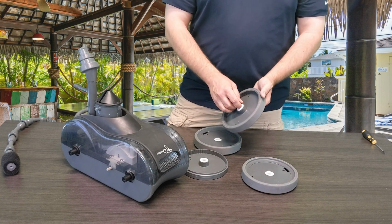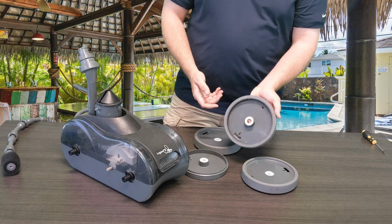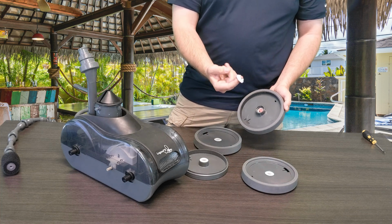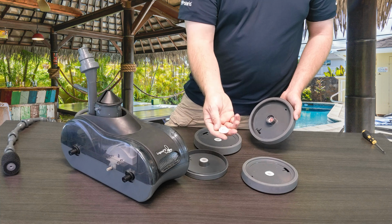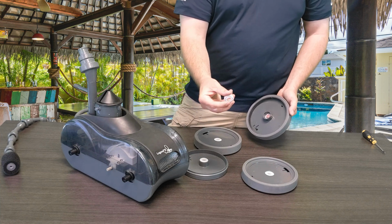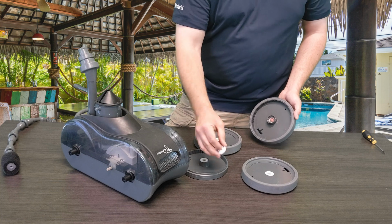Really simple. If you're already here with us, once you have the wheel in your hand, I like to keep one finger on the outside bearing, just gripping it gently from the outside, and then I'll take my other hand and go in and grab the secondary bearing. As you can see, when I take them out, they are different on each side of the bearing. One side has little notches and you can actually see the ball bearings, and the other side is a smooth area where you can't see anything, everything's smooth and covered on the other end.